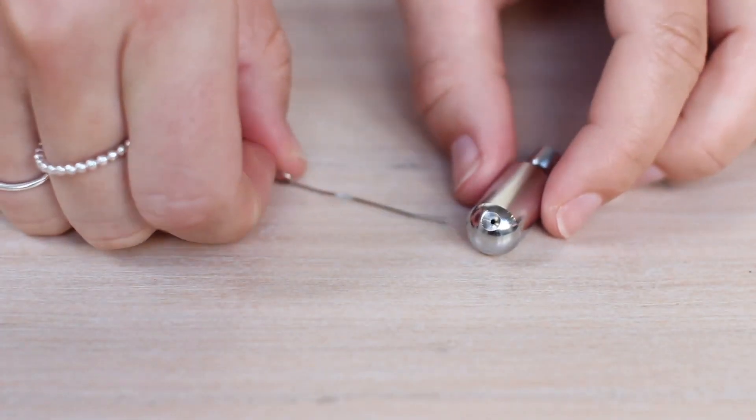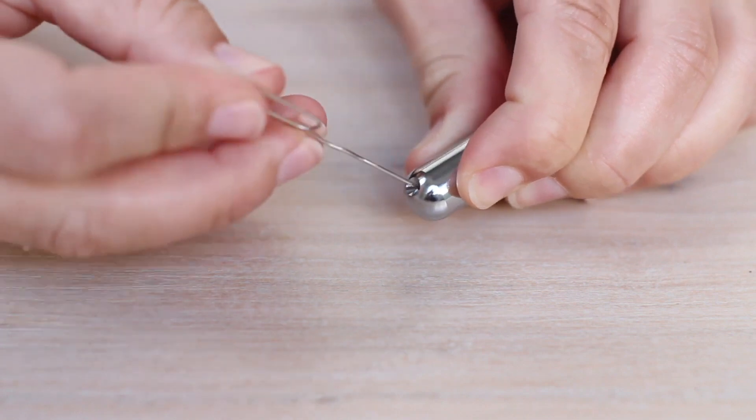The best way to keep your little steam jet perfectly clear is to give it a nice big purge every time you finish texturing your milk. If your steam tip does get blocked, the best thing to use is a small paper clip, as the blunt end is much more effective than the sharp end of a pin or needle. Remember that after a cycle, a little bit of extra moisture can be left in your steam wand, and when you start a new cycle those little drips of water can drip out the end of your steam wand — it's not leaking, it's just remaining condensation.